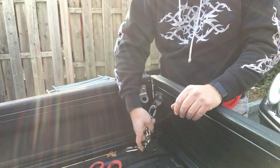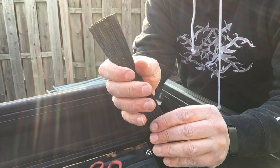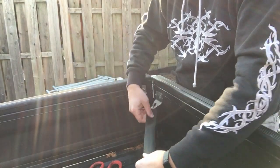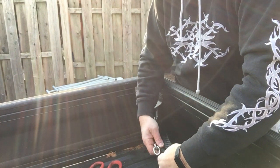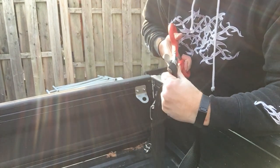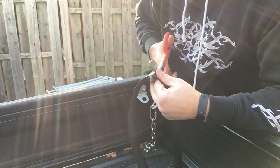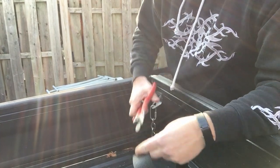We've got these on. The last thing I'm going to do is sleeve the chain with some wire loom protector or hose protector mesh to eliminate any rattling while driving. I'm just going to cut this to the right length. This is optional — you could use a piece of old rubber hose or anything somewhat pliable.